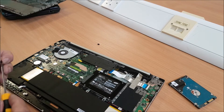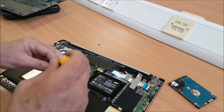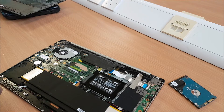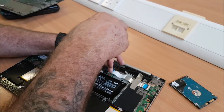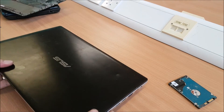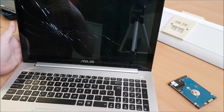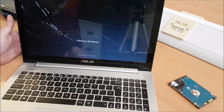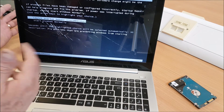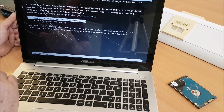Now she'll get set up in a minute and I'll get it powered up. We'll have a go and see if we can get an operating system on it and see what happens — I won't take you through it all. I'm not going to put the cover back on either — I think we should be alright without the cover. I just want to see if the BIOS picks up the hard drive. It's starting Windows — it's going to do that because it doesn't recognize the hard drive and Windows has to be redone. That looks pretty good for now. I'll go and reload Windows — it could have been the hard drive.